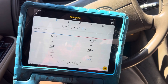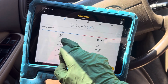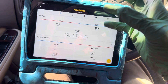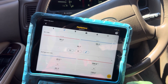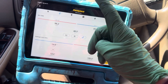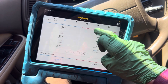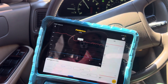We're now at 197–200 on the high side, 14–15 psi on the low side. The old fossil dinosaurs say when you're this low you need to be at 30 psi — let's get up to 3,000 RPMs. We need more refrigerant — let's get a can of AC Pro out here and fill this up because it's not in the green on those little gauges. Now why is it not in the green? Let me take my foot off the throttle and see what happens — we're up at 3,000 RPMs.